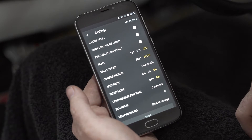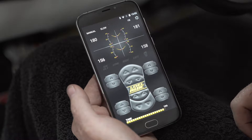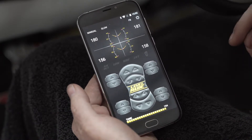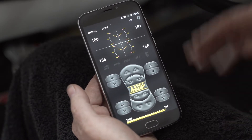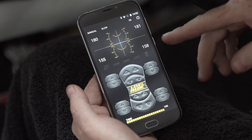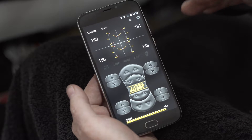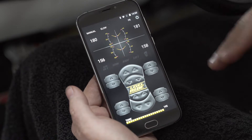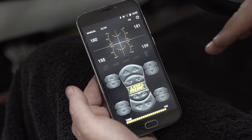What we're going to do now is calibrate the system. You set the vehicle up to the amount of pressure needed to reach maximum height — not maximum tank pressure, but the suspension maximum. We needed 180 PSI to max the suspension out in the front and 155 to 160 PSI in the back. We always start at the top of the range and come down so we work out our drop rate straight away, then work out all our corners and movements to get the calibration set up on level ground.